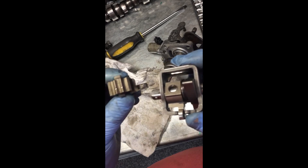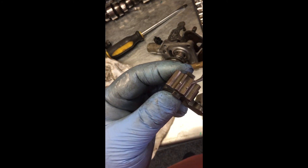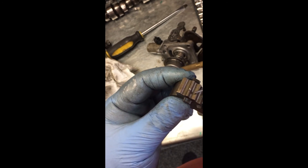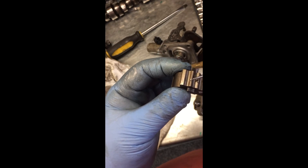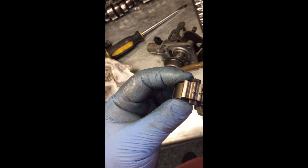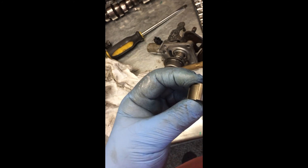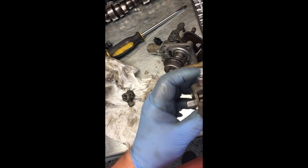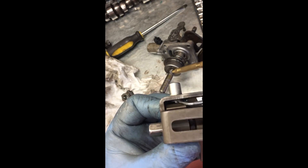This little block has three detents in it, similar to the ball-and-tension-spring detents that hold your shifter into a secure spot so your shifter forks are in the right place. If there's too much wear on these lands, you should replace this block. There was another guy on YouTube — I'll put his name in the description — who first indicated that replacing this block might help shift quality if you had popping-out-of-gear issues. The spring and ball are located in this pin section of the selector.